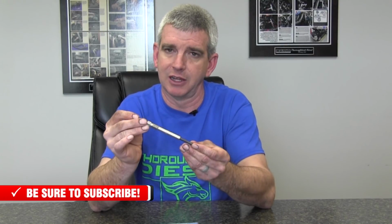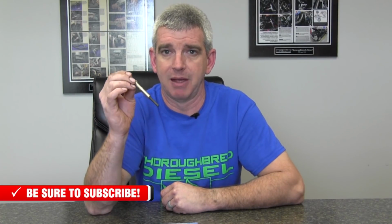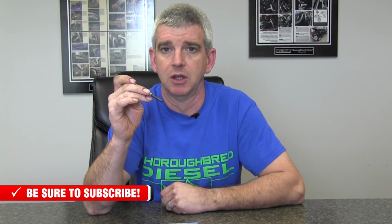The materials used in the manufacturing of DieselRX's glow plug resist corrosion and damage caused by vibration. They've got superior electrical insulation and high thermal conductivity. Conductivity is a really hard word to say. These glow plugs also have a dual coil design that allows for faster heat up and stabilizing of the temperature of this glow plug. That's one of the things that makes the glow plug more robust, and it's going to last you a long time. You're going to get good performance out of it. And the heat concentration is in the combustion chamber where you actually need it, so you don't have this heated all the way up the coil here. It's concentrated in the combustion chamber right where you need it.